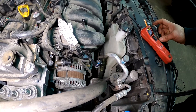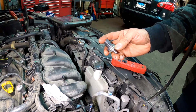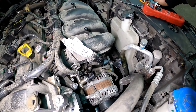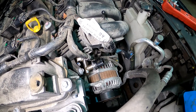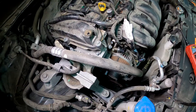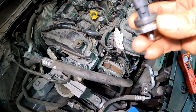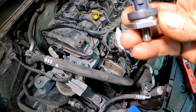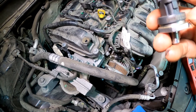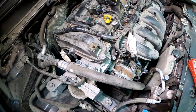What happened here is I ordered one sensor from Amazon with the same numbers, but after I put that one in I got a different code. It turns out it was pulling to ground, so I was getting a P0192 code — no longer the P0193, but a P0192. The sensor I got from Amazon had the same numbers: 0261545074. It didn't work; it just pulled to ground. So either it was a defective part or something, because I grabbed the same number and everything, but it was pulling to ground and giving me a low voltage code. I already checked my wires and the wires are good — we're getting ground, we're getting the five volts.